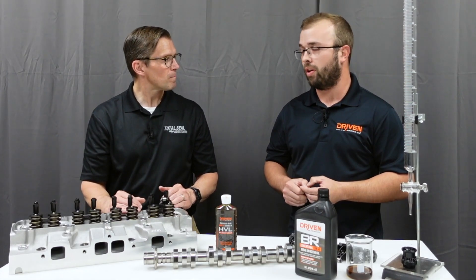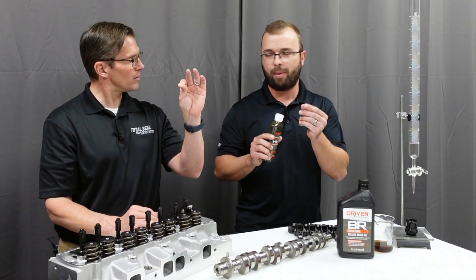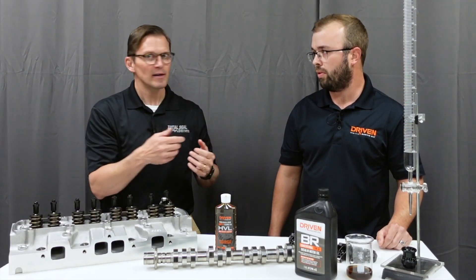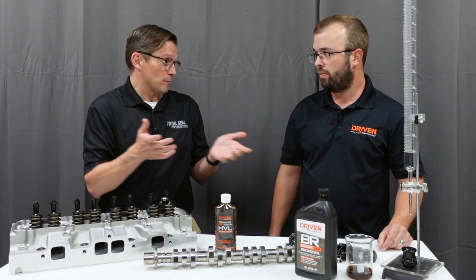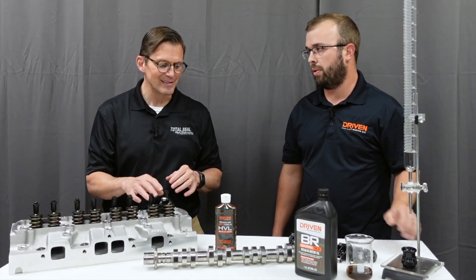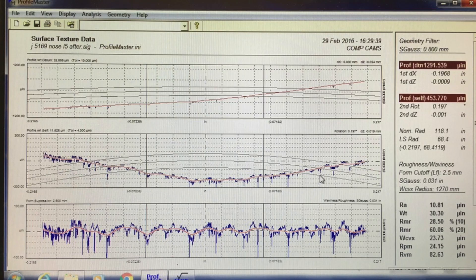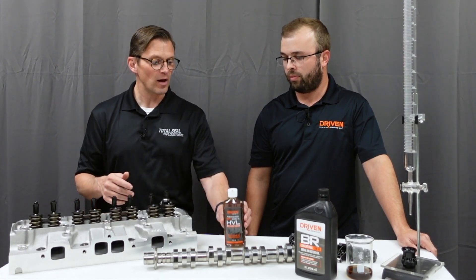The best thing about doing it with the base oil is it's very shear stable — it's going to be what it's always going to be, it's never going to change. You can feel the viscosity — engine builders grab it and they can feel it. There's substance in here. It's not just tackifier chemistry, which will make it stringy but doesn't add any bulk or viscosity. So if you've got a high compression engine you're putting together and you roll that thing over, the skirts, the bearings, everything in there is going to be properly protected during that most critical time. From all the testing — cam wear testing, grease testing — the majority of that valve train wear is going to occur in the first two minutes.